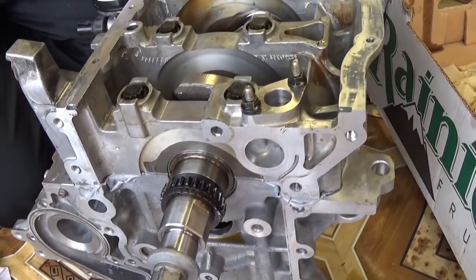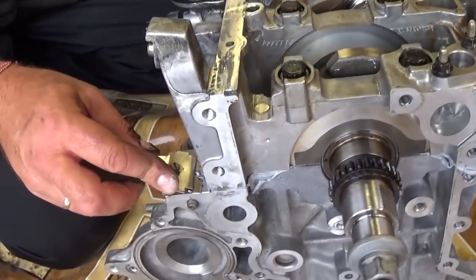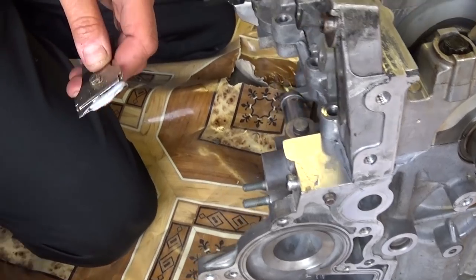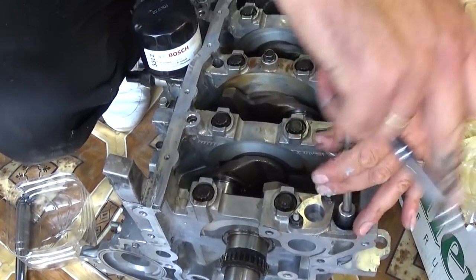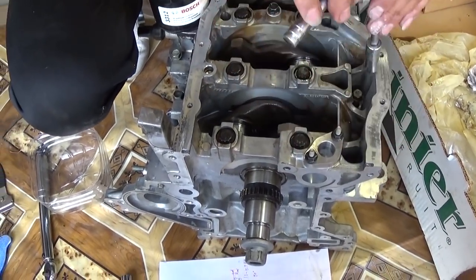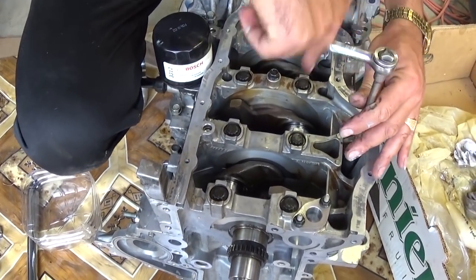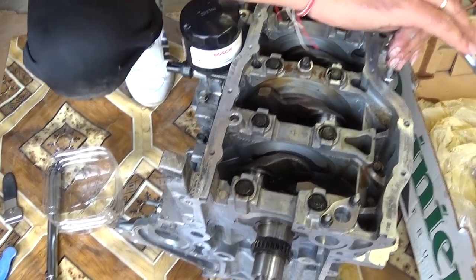So on the outside wall, the silicone, the sealant is still soft, we're going to clean it. That way we don't have excessive amount later. Okay, you can see, so it can look real nice and clean. So do that while it's soft. So we installed the lowercase bolts now. And we'll just get them tied by hand until they stop going. And after that I'll share the torque specs and the sequence with you. It's very important sequence again, do not get them too tight.